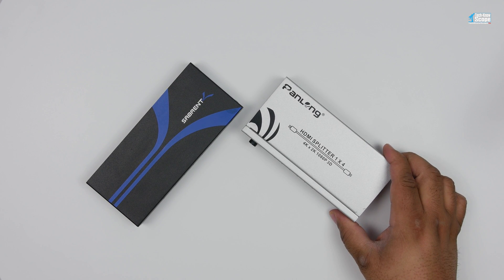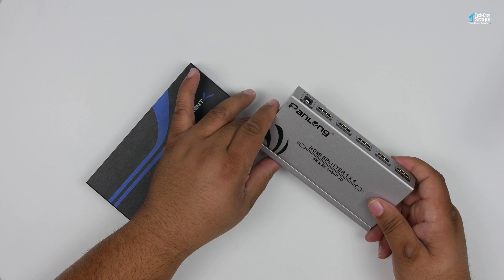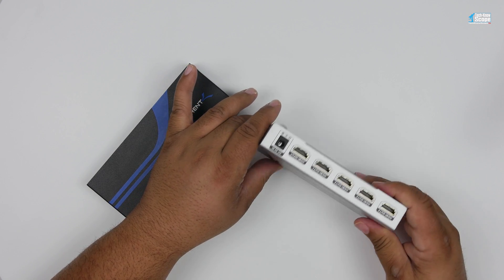The device that does all the magic here is what they call an HDMI splitter. The original intent for one of these is for commercial use — stores, malls, displays — where you'll have one source but you want that one source hooked to many different screens. Copy protection is designed so that everything works on a one-to-one basis: one Blu-ray player and one screen. This is called a one-by-four splitter. They have different ones — some only split the signal into two, some split it into up to eight, and you could probably have them custom built.